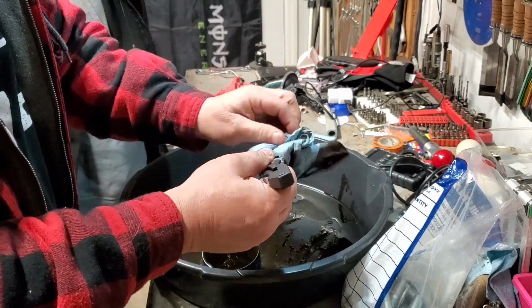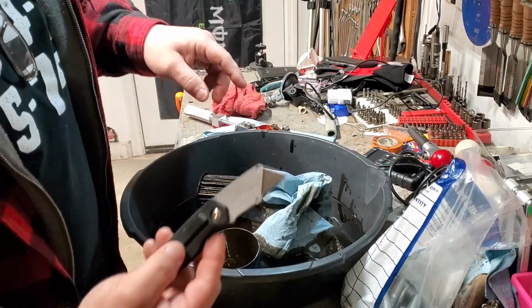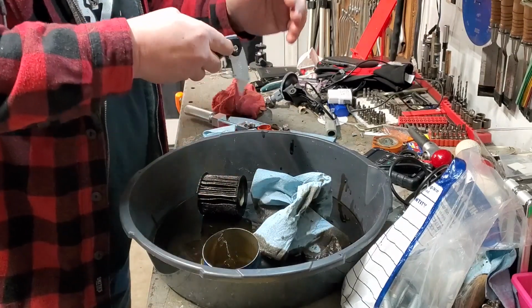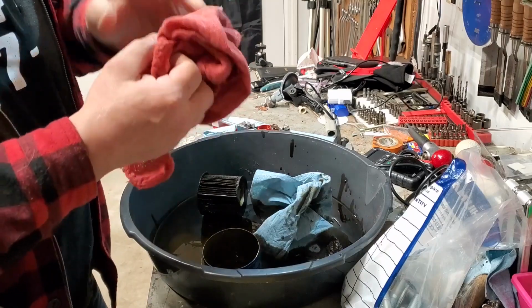So, guys, that was the problem. Now, you're thinking, well, how does all that trash get in there? Well, I can answer that. We're going to keep that oil changed. For the first 6 months, I'll probably change it about every 1,000 miles.